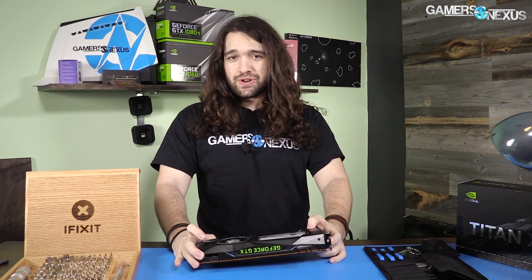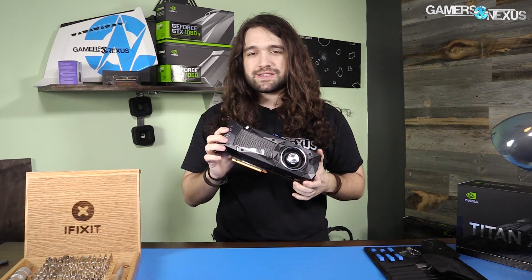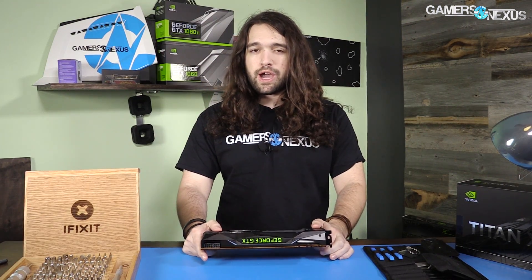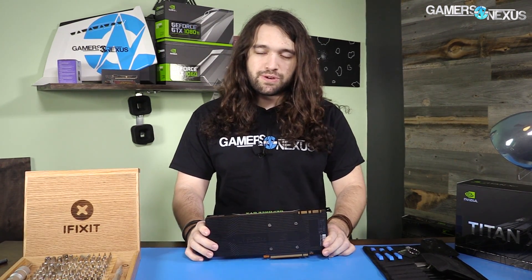For him, we are going to be converting this into a hybrid card, which will give us some extra clock headroom and stabilize things a bit. We'll have a full review online as well. But this is going to be a teardown: part one, we're taking it apart and looking at the PCB; part two, building it up, which will partly serve as a guide for a hybrid mod; part three will be the results on how it has improved with the liquid cooling kit.